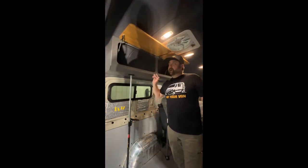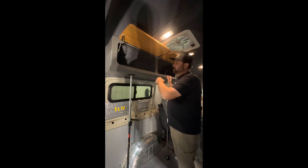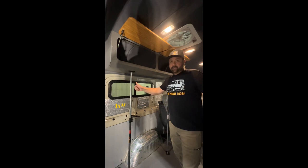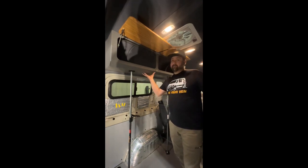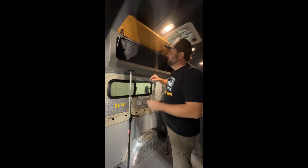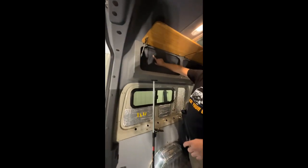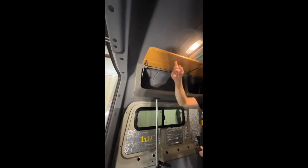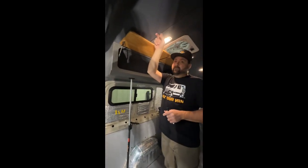The first phase of mounting these cabinets into your Sprinter with a stock headliner is to set the cabinet in your desired position. We have this one set up with some load extenders and some leveling jacks. These come in real handy to support the cabinet in place while you decide which direction you want to shift it and mount it. In these vans, the headliner seam usually always lands on a structural roof beam in the ceiling of the van.